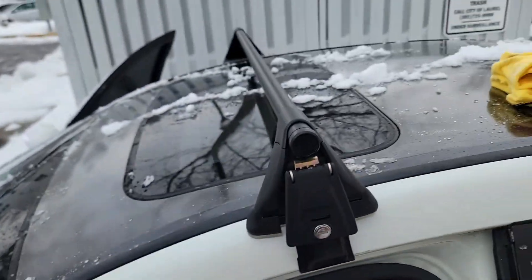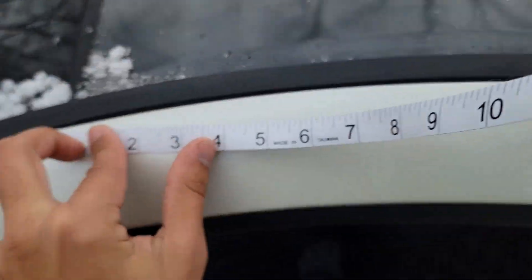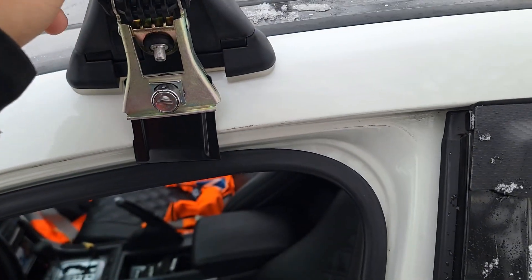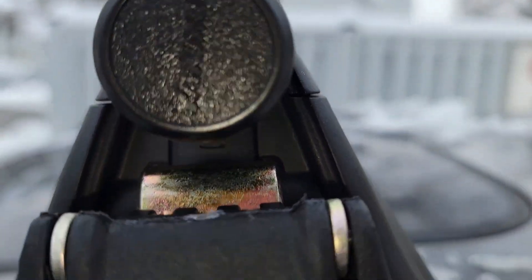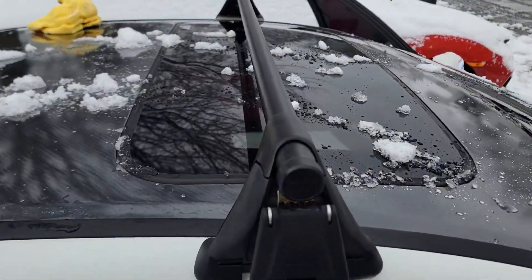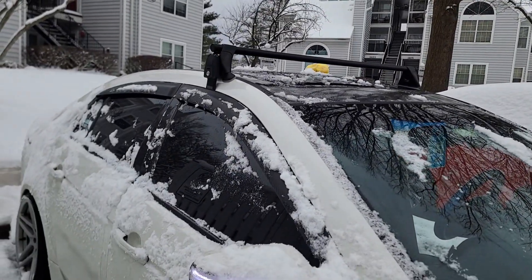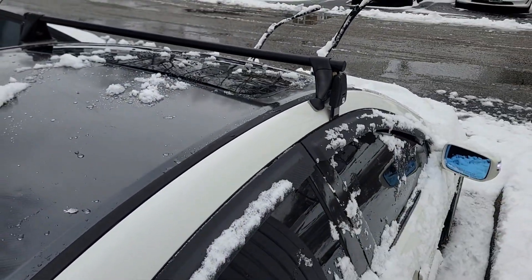We made it outside and I got the roof rack — it's not all the way on but I got it placed in the right spot. What we had to do is measure from the start of the paint of the roof into the Q tower, and it should be 11 inches. Literally on the money — I did it on both sides and it's perfect. Now I have to open this up and turn this back and forth until it gets above this notch. The gold plate has to be right there at that notch. The front one is tightened all the way and it looks really really dope. I can't wait to see what the other one looks like — and then plus with the snowboard on top.